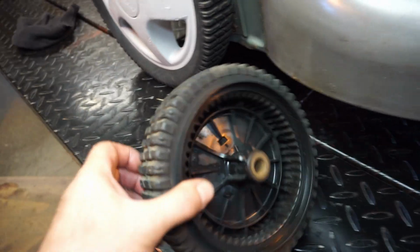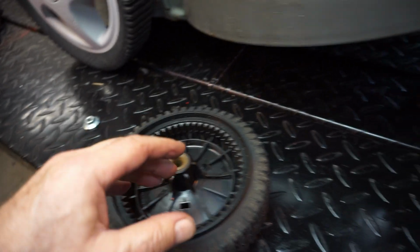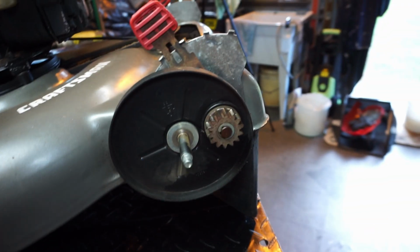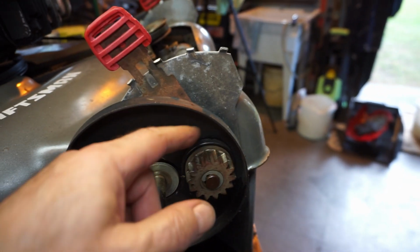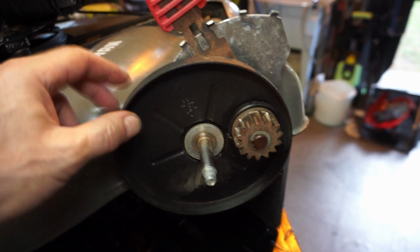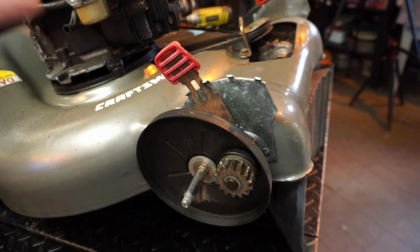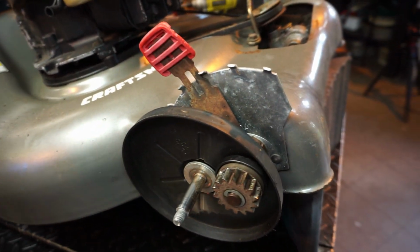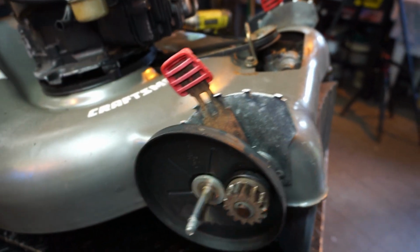And of course, you know, when I was pressure washing, there's a lot of junk that gets in here. Get everything cleaned out, pressure washed it, and then usually before I put the wheels back on, I squirt oil into everything because I got water on it, and that's my first lubrication. Check your backing plates, make sure they're in good shape. That way you keep it nice. And I'm gonna do this with dirty hands and everything that's oily and greasy before I finish up. I'm gonna make sure these adjusters work, get them lubed.